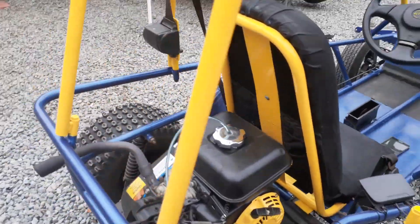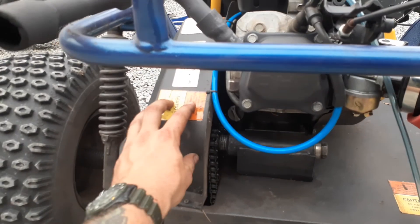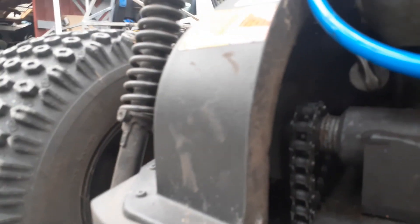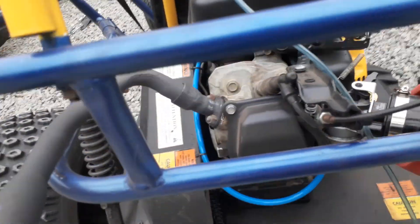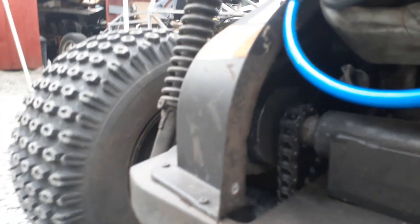What I've done to it — I can't find anybody else online that has what I have here. It is a double chain on a jack shaft. This originally came with a centrifugal clutch on the motor and a jack shaft that was belt driven, and then it went to the rear end via chain — a 40 roller chain. So what I did was eliminated that. I got a chain-driven centrifugal clutch with a 23-tooth sprocket on a 5/8 keyed shaft, and that seems to be a really good ratio for takeoff.